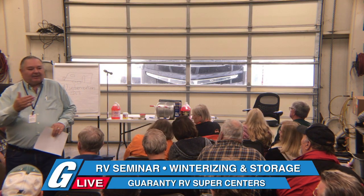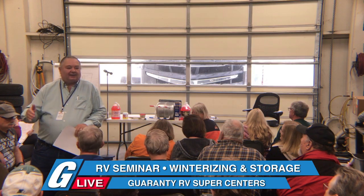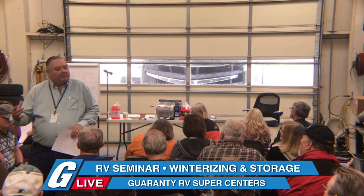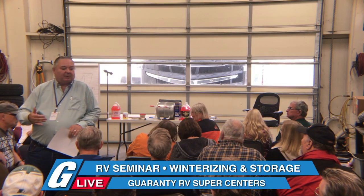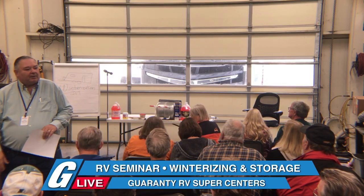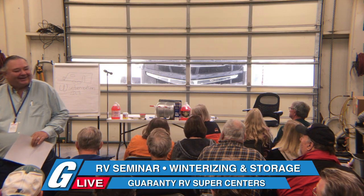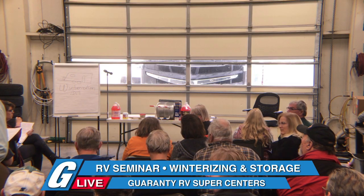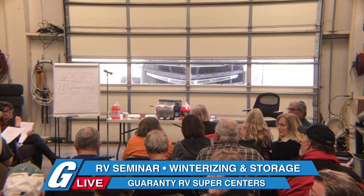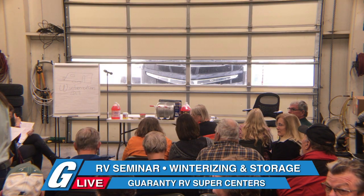But I will give you partial credit on that, because that's why I like to use a little bit more than the minimum amount. If I pour a cup down there, that's more than enough to displace any uncooperating water. Not a gallon, no, but a cup will work. Yes, sir? If you want to get it out before you pour your antifreeze in, use a boiler pump. Yes. Okay.